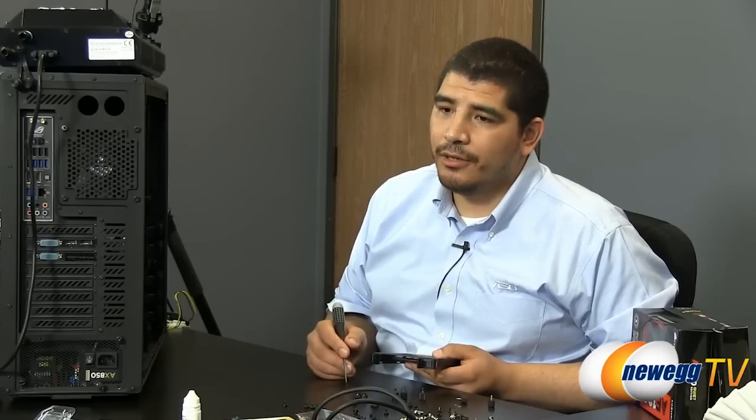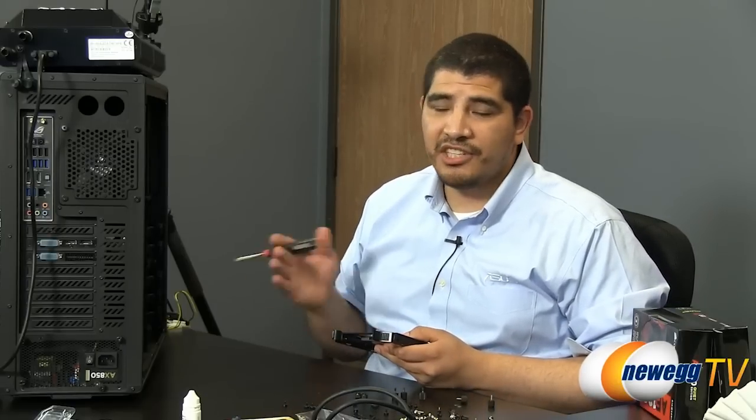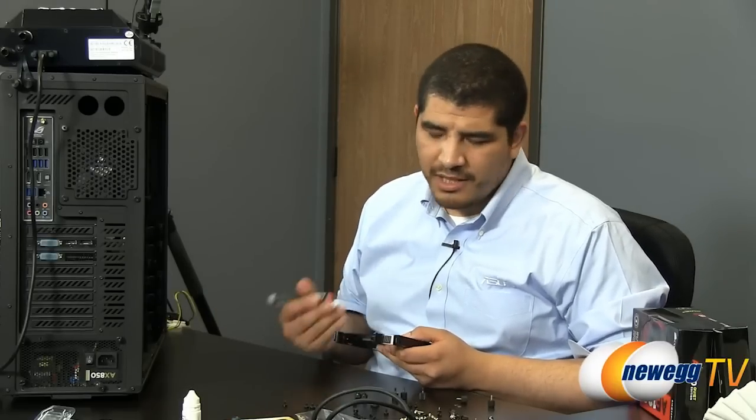But if the system has a little bit of room, I would probably recommend at least getting a very basic GPU. It doesn't have to be expensive. It could be something like a GT 640, or an HD 7750, something not very expensive, but it would accelerate any of the web or multimedia-centric aspects that you're starting to see, especially with HTML5 becoming more and more popular in a lot of coding. It could help to maintain the peppiness of your web browsing experience, along with the SSD that you're incorporating in there. So I think the CPU choice is fairly solid. I think that's overall a fairly peppy build.